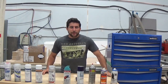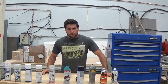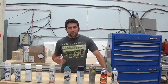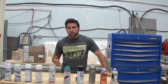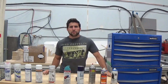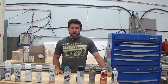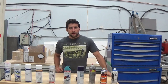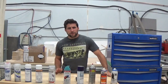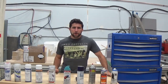It might delaminate after a day, turn flaky, stuff like that. Whereas if you just sand it lightly first — I know it seems daunting — that allows the clear coat to adhere. If you use a fairly high grit, I like to go with 800 when doing something like that, the clear coat fills in all those sanding scratches anyway and you'll never be able to tell it was sanded. The exception is with metal flake, where sanding can mess with the alignment. In those cases you still sand, then put a very light coat of metal flake on and clear coat.